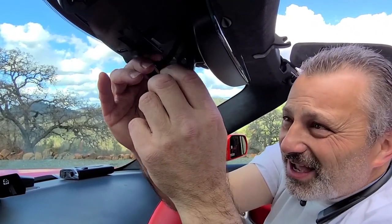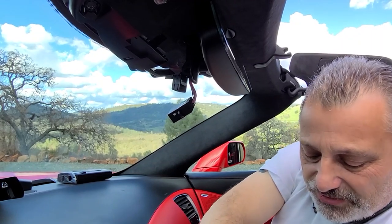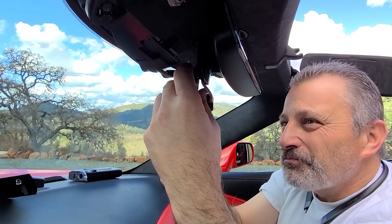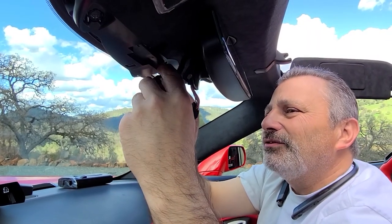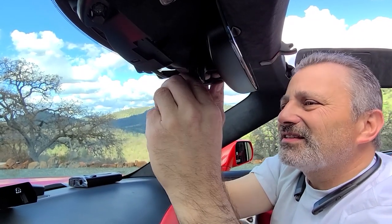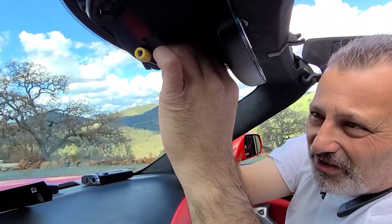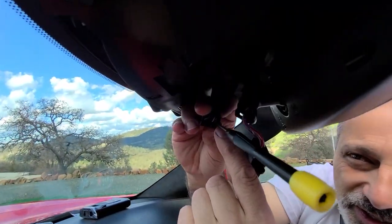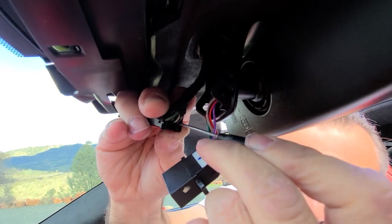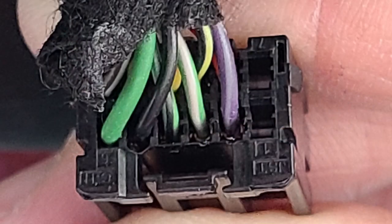Now, these sockets are extremely tight, and you're not just going to be able to slide this little guy up in there real easy. So what you have to do is take yourself a small little screwdriver — like you'd get out of an eyeglass kit or something like that. Then you can go into the plug and — let me see if I can show you this. All I'm doing is I'm going to put that into the plug, and I'm just going to wiggle it over, just kind of bend the plug a little bit, so I'm making a little bit of room in there. I'm going to do that on the purple and the black one.